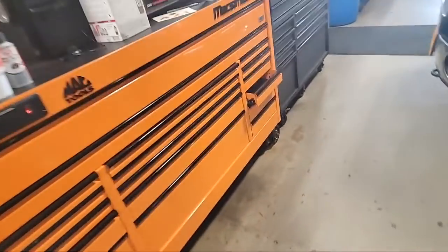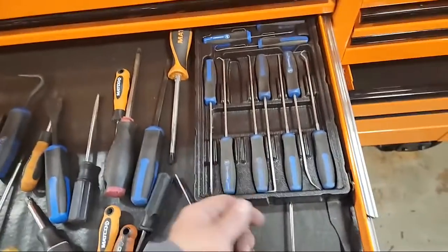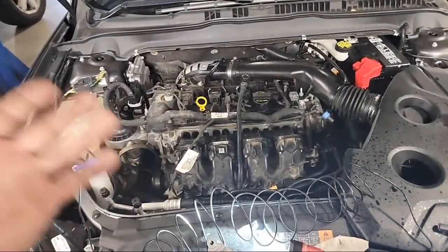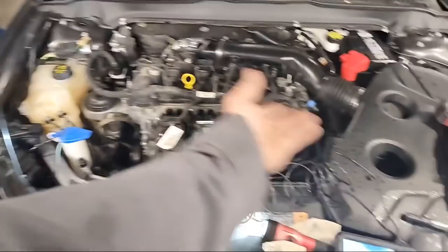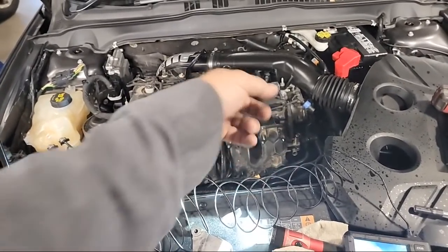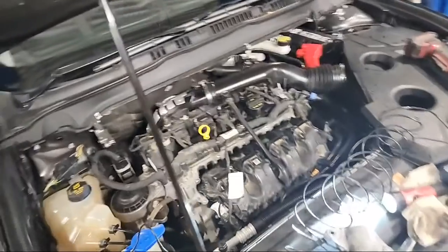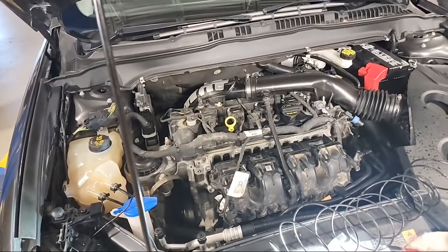You could get a little pick set with all these different angles and hooks and sit there and pick the carbon off. You can get a walnut blaster machine and walnut blast those while sucking out on one side and blasting on the other. It's just a matter of how much you want to do. It's a super easy job — I'd give it a three or four out of ten. It's just taking a bunch of bolts apart, and when you put everything back together pull your manifold up nice and true before tightening bolts in a cross pattern. Anybody could clean their valves.